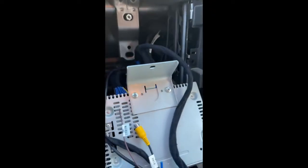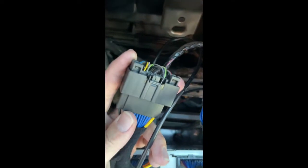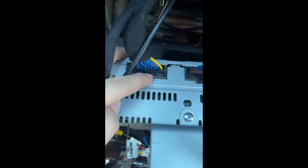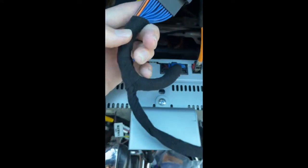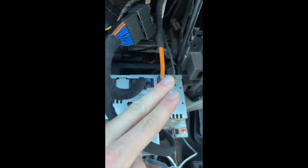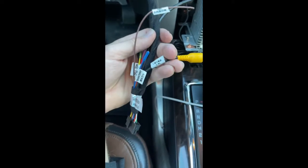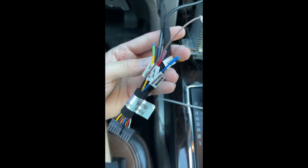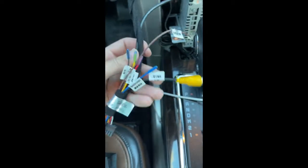The two cables that come with the kit need to plug into the back of this. There's a male connection and a female connection — the female plugs into the OEM cable. This is plugged in originally but you pull it out and plug the new cable in, same goes with the other one. Don't touch the two antenna cables — those are for SiriusXM and regular FM. The far-left cable is for a front camera or similar, and there's also reverse detect, AC, 12-volt, ground.